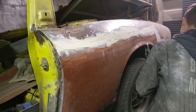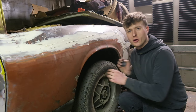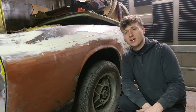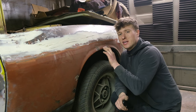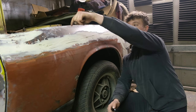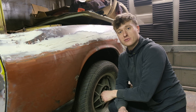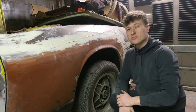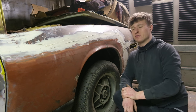It sucks that we've put quarters on. Filler is always recommended to be applied to bare metal, although apparently you can use epoxy primer. There we go — all skimmed up nicely. Now a lot of the repairs around the rail at the top took me absolutely ages; it really didn't even want to be filmed. As I said in a previous video, this panel was £74.50 plus VAT. I could have got a panel that went right to the top and all the way to the rear lights — there's a huge price difference. The genuine reproduction panels cost £1,075 plus VAT. Yeah, completely out of budget — don't think it's worth it at all.